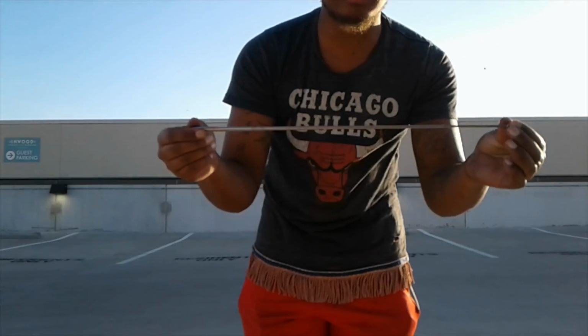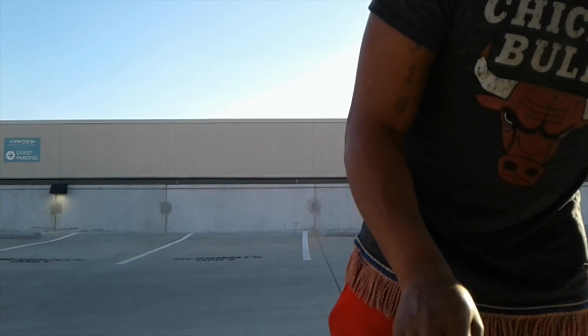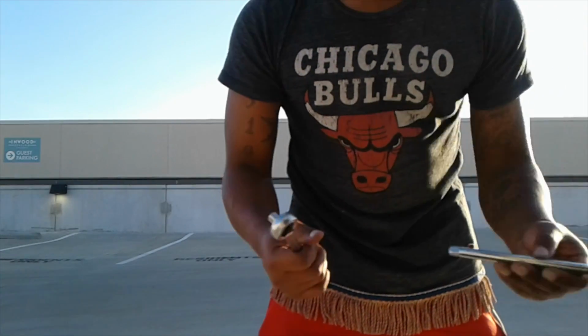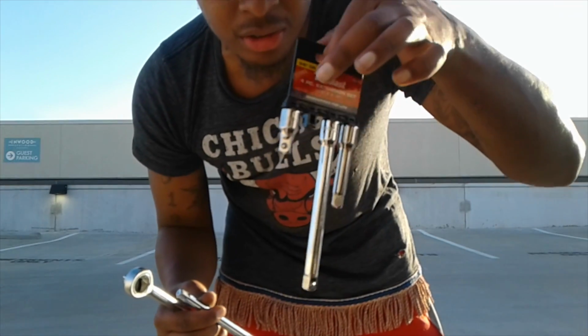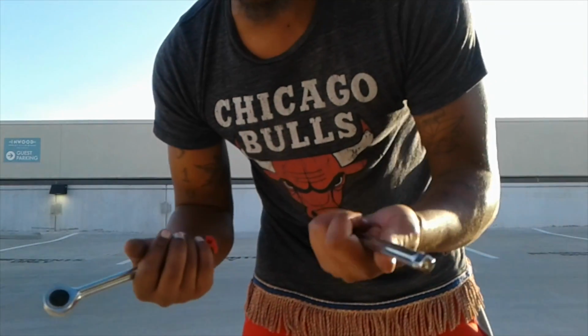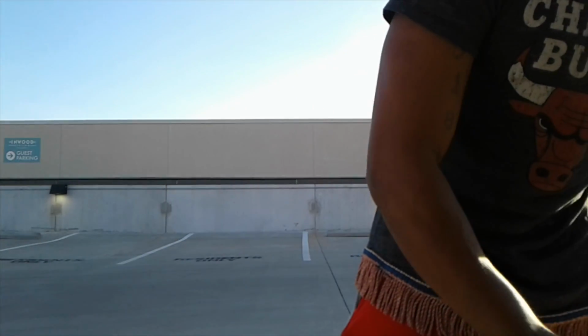In the beginning of this video, I'm going to put the tools that you need, and also in the description. You will need a magnet. Hold on, let me show y'all. You need a magnet that extends out so you can get the plug. And then you're also going to need a 3/8 drive with a deep socket. You can get this at AutoZone. I paid like $13 for it. You need it because you can't reach down and get it by yourself. So let's check it out.